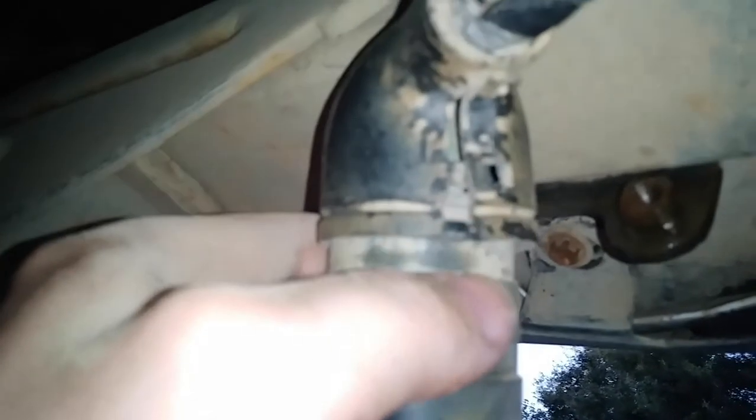There's a little latch right here you can undo - just pull a screwdriver in there and pop it out. When you do that you can split the piece apart and look inside - you can see the wires. All the separate wires are wired directly into this. So it doesn't appear there's any kind of USCAR port or adapter to plug into, unlike some domestic trucks. This doesn't come apart and unplug - you just have the wires right in there. So options where you plug something in to replace the seven-blade adapter just won't work.